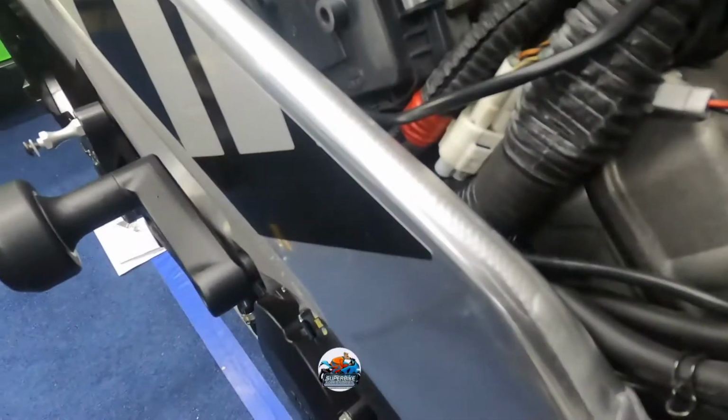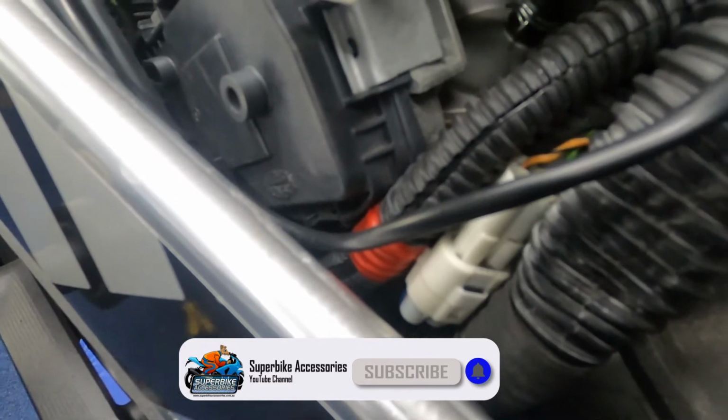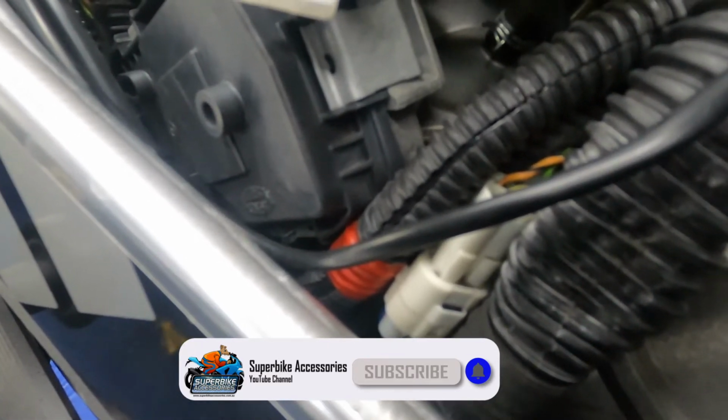This is where you will have to plug in the quick shifter module sensor. So that's the cable for the quick shifter sensor. This is normally where the OEM quick shifter is connected. This is the gear selector plug, which we'll have to hook up to the module now.